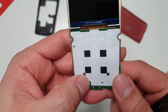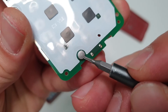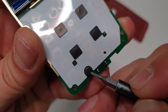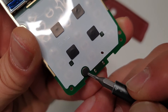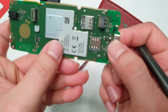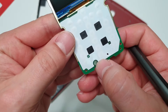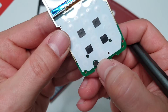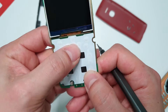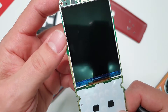We're going to flip it to the other side - this is the microphone over here. Again, this is not user-replaceable, and it's going to be very difficult to repair by a non-skilled mobile repair person simply because it's soldered directly to the main board. If this phone gets wet and water gets into the microphone, basically the main board is toast.